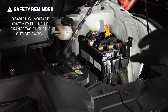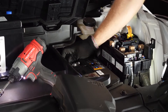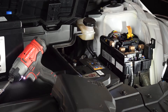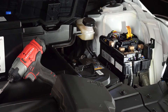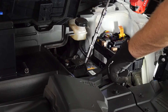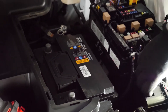As a safety precaution, disable the high voltage by pulling that tag up — once it unclicks, it's unlocked, and that's a very convenient spot for it. Now remove the negative terminal: loosen it, wiggle it, and lift up. Once you've taken the negative terminal off and pulled the high voltage tag, the car is totally powered down — all lights off, everything dead. Then remove the positive terminal the same way: loosen, wiggle, and lift up.